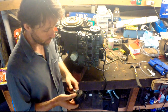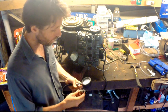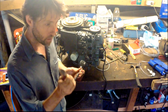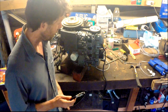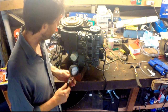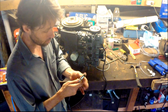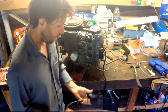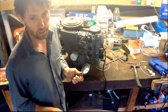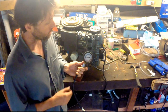There are plenty of YouTube videos on how to do a compression test. But really, what you've got is a compression tester — pretty simple device. It just has a little one-way Schrader valve in there. As the engine turns over, the piston compresses air in the cylinder and pushes it out through the spark plug hole, which is where this tester gets inserted. The gauge reads what sort of pressure we're getting. If it's leaking back out past the rings, you don't get a high reading. This tester has an adapter on it because these spark plugs are a slightly smaller diameter than many other spark plugs. There's also a little pressure relief — once you've done a test, make sure you hit that so you don't carry over a high reading from a previous cylinder. If you don't reset it, you'll only see readings that are higher than the previous one.